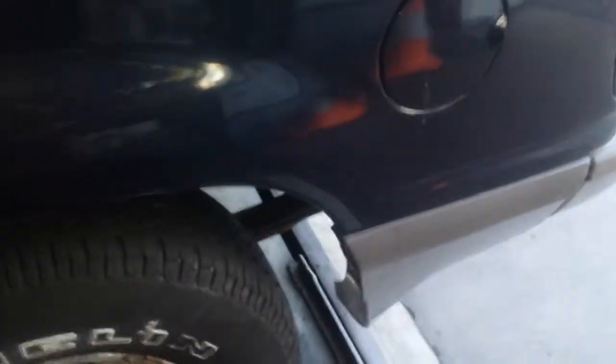Let's take a look at the canister. That's going to be located on the driver's side rear corner panel. You can see it right there — that's the actual canister. What we're looking at is between the frame rail and the chassis, above the spare wheel. That is the evap canister itself.